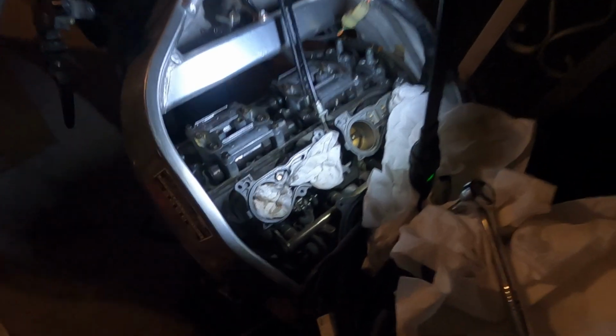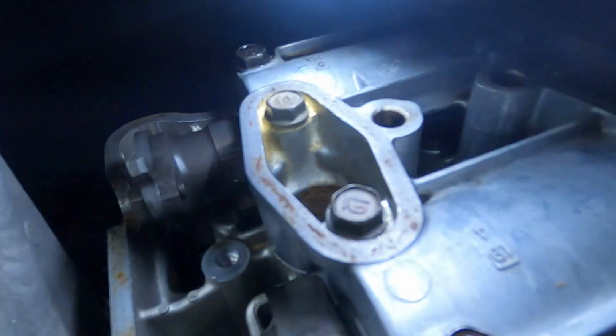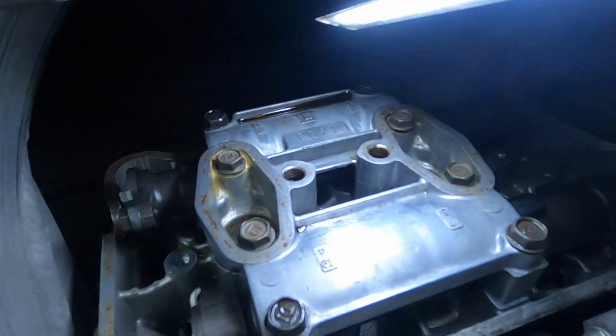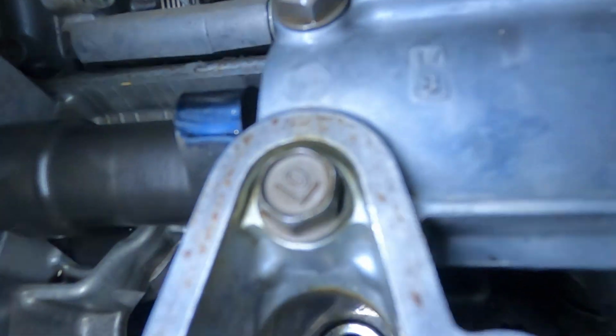All right, update time. I managed to pull the head off of the motor. The motor is still in the bike, but I managed to pull the head off, and then all I have to do is basically get all of these 8 bolts and then these 8 bolts over here. As you can see, spark plug wells, and in there is where the spark plugs are seized. There is where that one is seized with the tool that's stuck in there, and you can see the rust